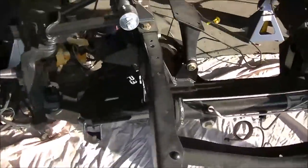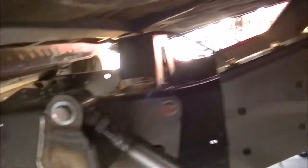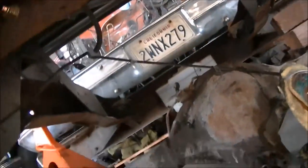The full Porter-built suspension - Porter-built arms, cross member, Crown Suspension drop spindles. So we're under the truck right now. To remove all the brake lines, you have to take these little clips off that go all down the frame - see the one here, there's one right here, and the one right here. So you've got to remove all those from all over the frame, and then we're going to yank them out from the back since we already unhooked it from the rear brake.